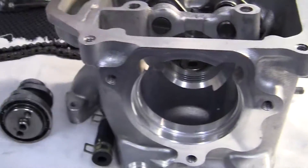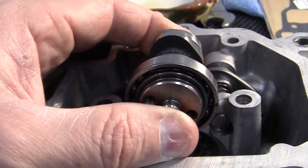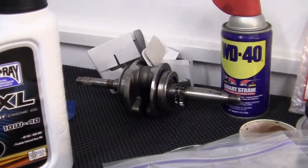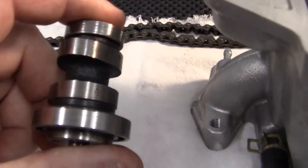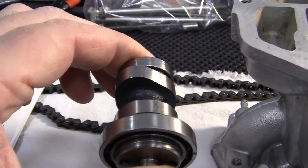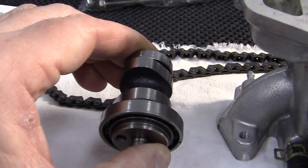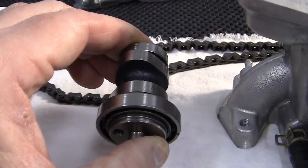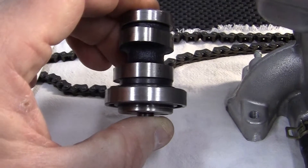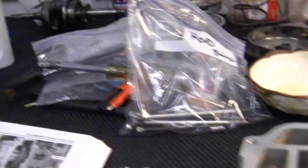The trick is to get the camshaft in proper alignment with the crankshaft right over there — you can see it right there. The crankshaft and the camshaft work exactly the same, connected by a chain, and they have the exact same rotation. Either the camshaft and the crankshaft are in perfect alignment on the compression stroke, exhaust stroke, whatever it is, or you're totally done — it will work or it really, really won't work. The valves have to work in conjunction with the crankshaft lifting the piston up and down.